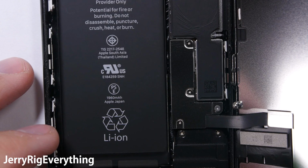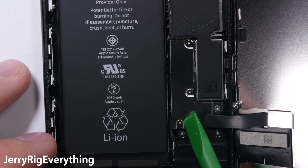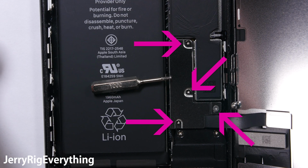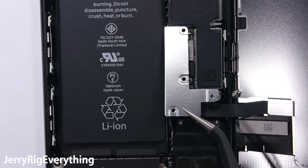They are for the screen, and if they get damaged, your screen might stop working and will need to be replaced. Apple can't seem to use normal screws, so whip out your Y000 tri-point bit to remove all 4 of these screws. Since most normal people don't have one of these laying around, I'll include a good inexpensive toolkit in the video description. Keep your screws organized. One screw is longer than the others, and we don't want that going in the wrong hole later on.